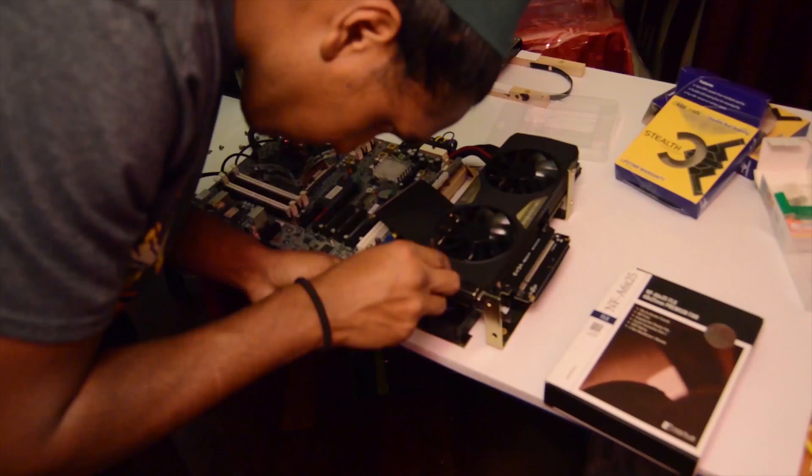We had a few issues — I bought really cheap hard lines so they were short and the quality wasn't the best — but we made it work for our application. I wanted specific bend spots so I didn't have to use any right angle compression fittings. After filling with coolant it looked gorgeous with this red coolant against the white board. Then I turned it on and we had a small leak that turned into a massive leak. It was through no fault of my own, except that I was too rough taking it apart and may have damaged one of the rotary heads on the right angle fitting. The hard line work itself was good — it was just the rotary fitting leaking.